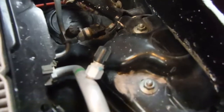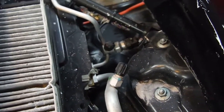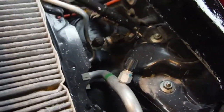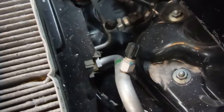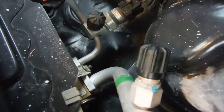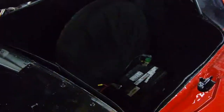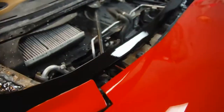Always remember, so this is the port I'm going to charge it from here, if I have that right. I have to look at the manual again. I'll memorize all this stuff. But what I'm thinking about, if I can get this fitting off, I'm going to screw this off and put a hose on it and then run that hose right through that firewall and put the connector in, mount it inside under the hood here, right? So when I get my AC recharged, I just do it from in here. Make some brackets and you probably never know the difference. A hose and then a connector.